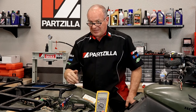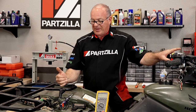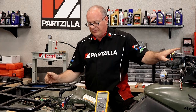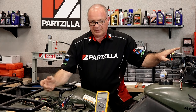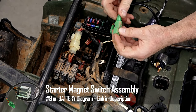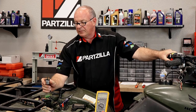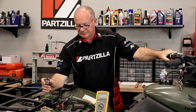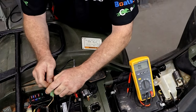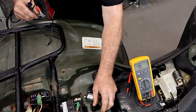What should be happening is the contactor should be coming up and sending voltage from one pole to the other, heading down to the starter. So the problem is I think we've got a bad starter solenoid. Even if we didn't have battery voltage coming up to that pole, if it was energizing properly you'd hear it click. I've got a new one over there — we're going to plug it in and then you'll hear that click I'm talking about. Now it should click — there it is. So I'm betting that when I replace this, it's going to start. Let's install it and see if I'm right.